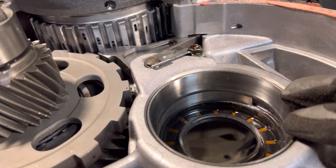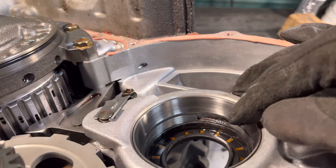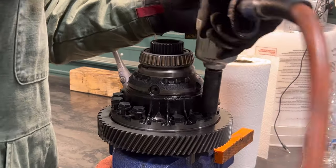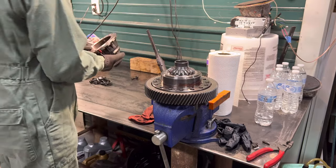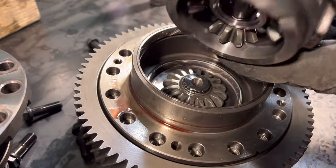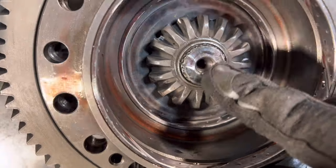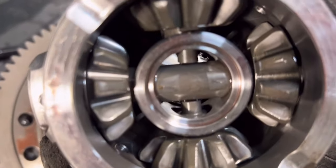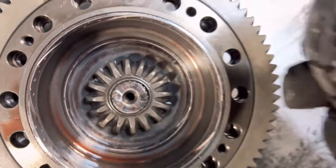Have a look inside this case before I put it down. This is the bearing race for that differential — you can see a lot of scoring; I can feel it with my finger too. And here's what we've been looking for. This is the axle shaft coming through there. It's got these marks on it — it looks like it got pushed through and hit right on those pins that hold in the spider gears, as it was pushed in too far. You can see the damage on it there.